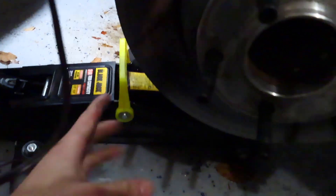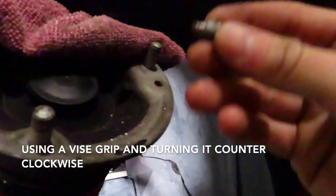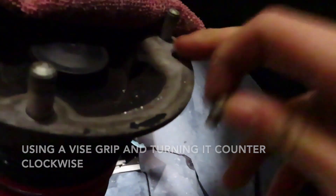So I got the end link out. I've been loosening these enough to where it'll slowly start dropping down. I have the jack underneath the control arm and I'm slowly letting this fall out. I think it is going to work to where I can replace the top hat without actually taking the whole strut out. So I got it to this point here where I have the strut swung out. I finally broke this alignment pin loose, so that thing is out now.